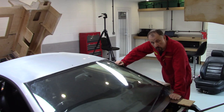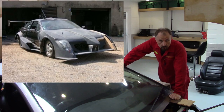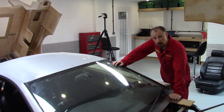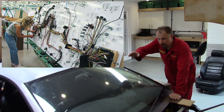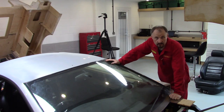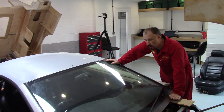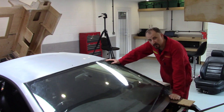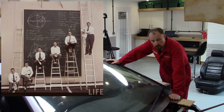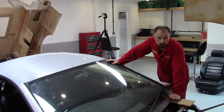So if you are going to use a more modern car for your DIY supercar build, you are probably going to find that the ABS system is intertwined with the wiring loom and the speedo and gauges and the rest of the systems of your car, including traction control and stability control. This means it's going to be much more difficult and probably much more expensive to use within your DIY project.